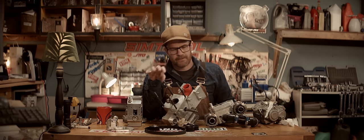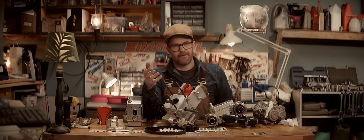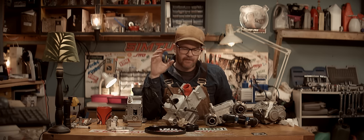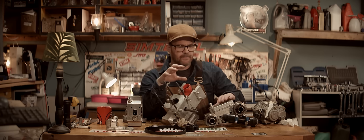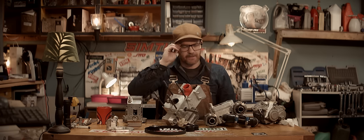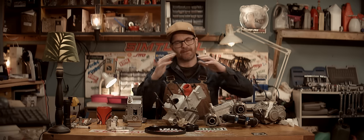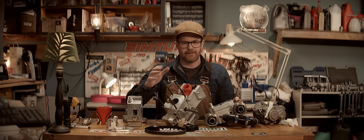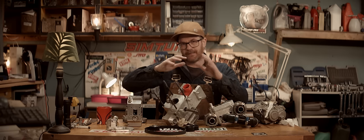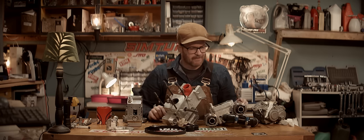There's huge potential here, because there's a reason it's called the brute force concept - the point is to just forcefully pump in too much fresh mixture and forcefully dump out a bunch of that fresh mixture before the rotary valves close. No scavenging finesse, just brute force - fill the cylinder. No concern about mixing fresh and spent gases, just pour through and purge the cylinder before the valves close.